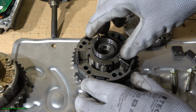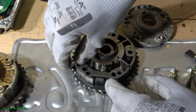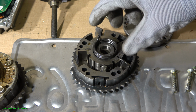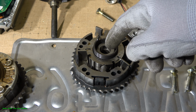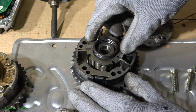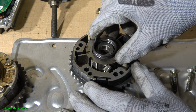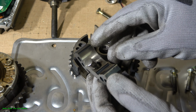Now when we look in that inner area, in my case it has happened that some of these sprocket parts are free in here, but the idea is that when this Vanos system works, oil pressure goes in there inside, and then this inner part moves in that way. It moves like that inside, this part. And when I take this part away, we can see that there is